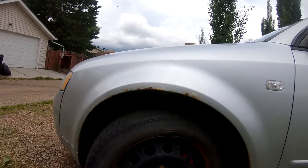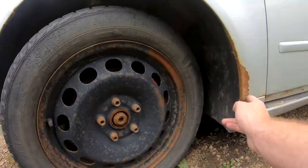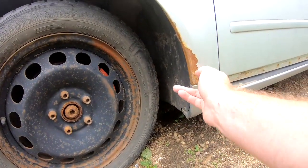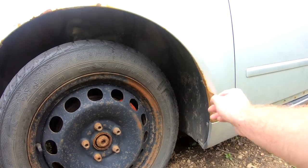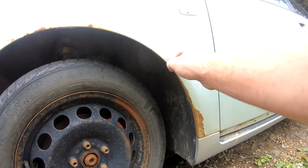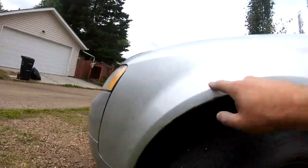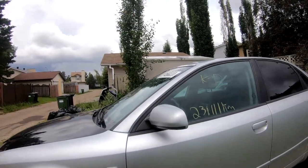But I will actually do it properly and get it good. Like down here at the bottom of the fender, I'll probably sand the whole thing. Have to take this bottom skirt out for a little bit, and I'll sand this all down up to about here somewheres, and then kind of just curve it and do all along the skirt here, basically. And we'll get it touched up.